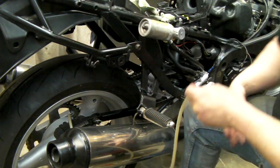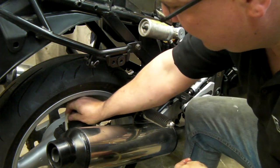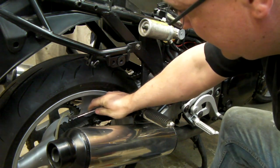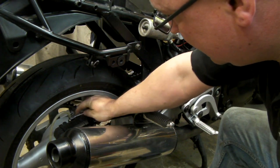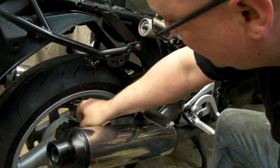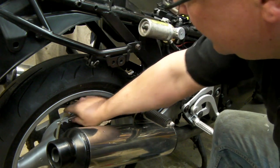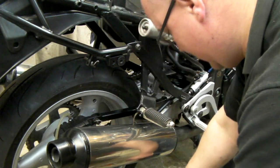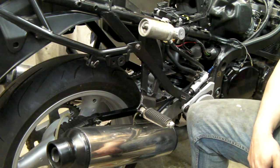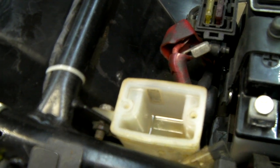The syringe just fell off and I've chucked fluid all over my hands — never mind. But we've now got fluid in the reservoir. Remember, brake fluid is evil stuff — do not get it on any paintwork; if you do, wash it off straight away because it will take the paint off. Pop the end of the hose back in the jar. As you can see in the bottom of the reservoir there's a tiny bit of fluid — that's all we need.